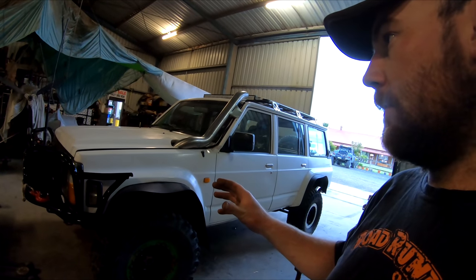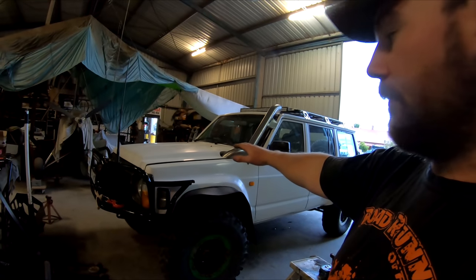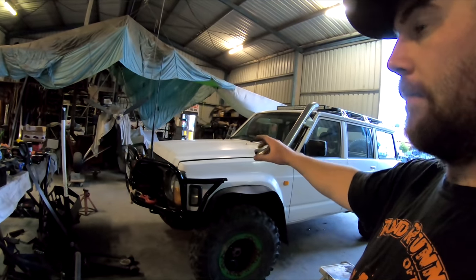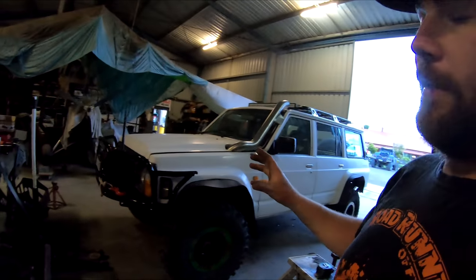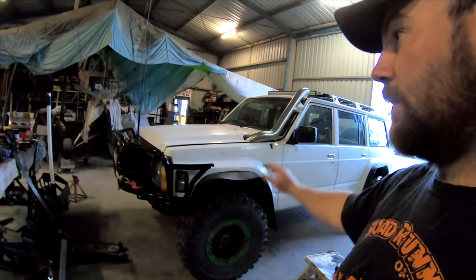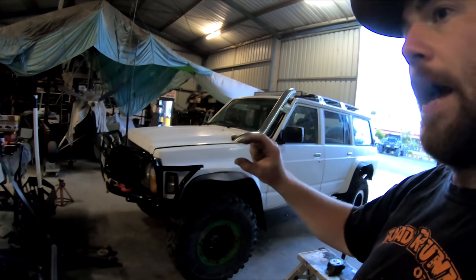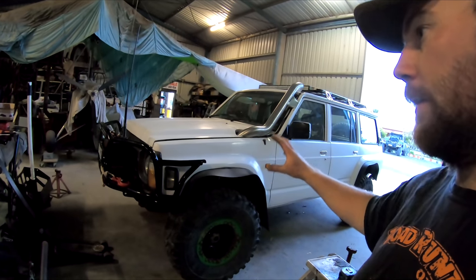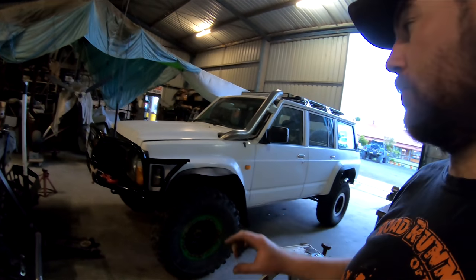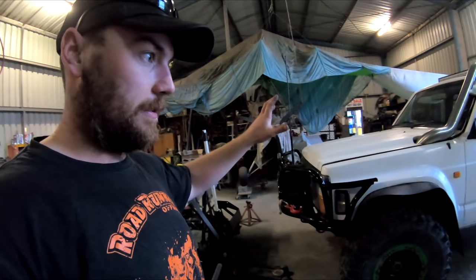Three quarters of an inch is about 19 or 20-odd mil. When it's at full bump with the car jacked up, there's about 18mm of shaft exposed. What that's saying is I've got five inches of up travel on the dot pretty much. Having that 18mm of shaft exposed allows for a super hard hit if it was to ever happen so you don't bottom the shock out. The shock does have a little rubber bit on the bottom just in case, but that's not to be used because if you case out the shock, that's drama.